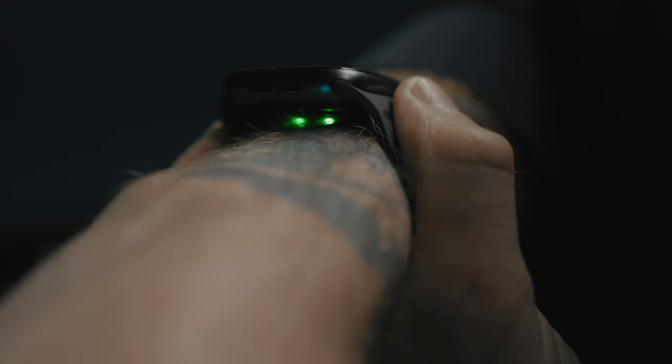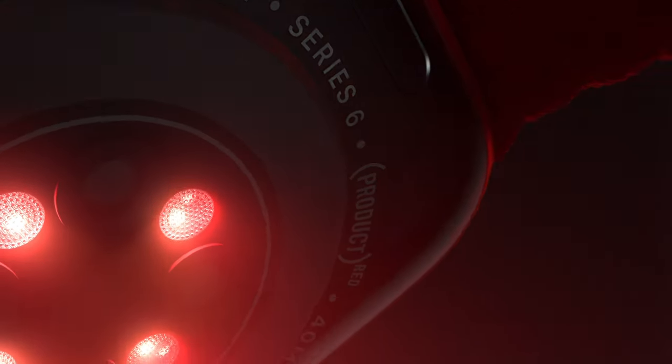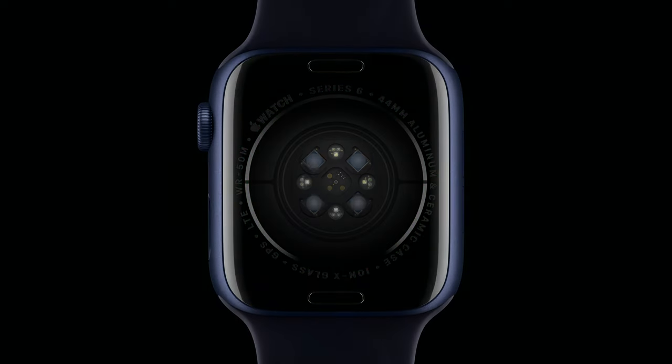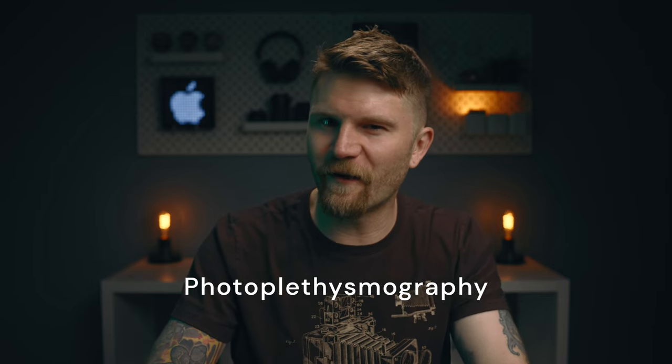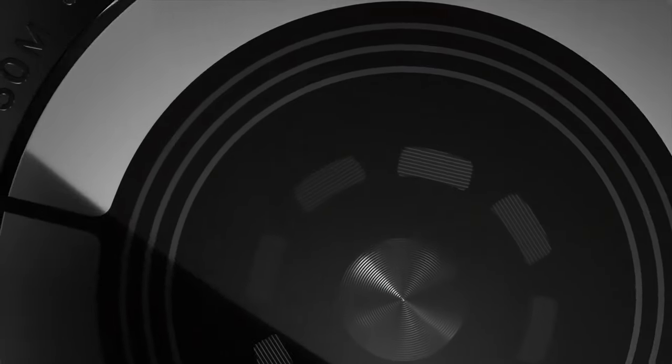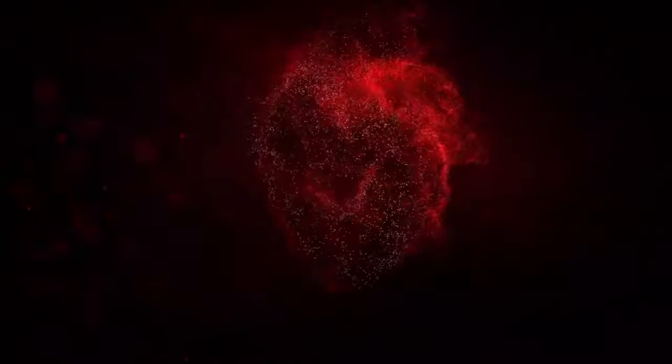If you own the Apple Watch or any fitness band, you'll have seen these green LEDs illuminated when you're doing a workout or an activity. And sometimes, if you have the right Apple Watch, you'll see red LEDs illuminated when measuring blood oxygen. Those are optical sensors, and they measure your heart rate by a process called photoplethysmography. Basically, how this works is it shines the green light against your wrist. Your body absorbs some of that light and reflects the rest back. When your heart beats faster, there is more blood flow, and the more blood flow you have, the more light gets absorbed by your skin, so the reflected light is less intense. The sensor detects the intensity of the reflected light and gets a reading from it. That green light flashes hundreds of times per second, so through the ups and downs with blood flow and light intensity, it's able to determine your heart rate.